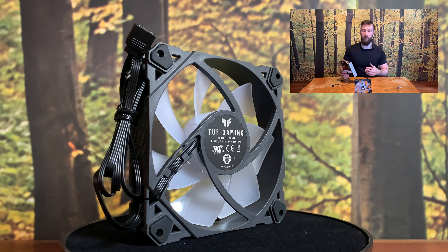Now you can check the stats of the fan itself. From the front side, probably the most important information from Asus is 76 CFM — that's pretty solid. RPMs: 1900. That's fine, it's higher mid-range. And 76 CFM is decent. So you can definitely use this fan as a case fan, and 2.5mm static pressure is not Noctua style, but it's in the higher part of the chart for these numbers, so it's definitely fine.